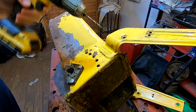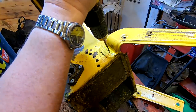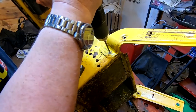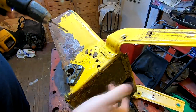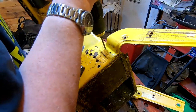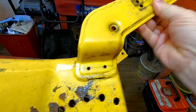I'm just going to drill a 4mm or 4.5mm hole at the moment. I don't really need to put the right size in because I'm not sure what size bolts I'm putting through yet. But as long as I've got a pilot drill going through both layers, that's where I can line it up easily. There we go — as you can see we've gone through both layers, so when I do cut the welds I've got the holes in exactly the right places.